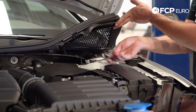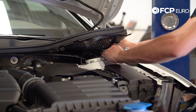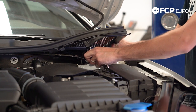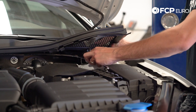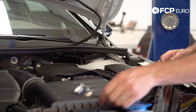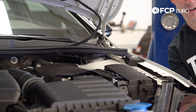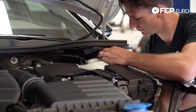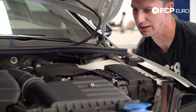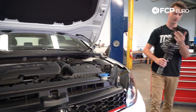I like to break all three bolts loose, then leave one in. I'll take two out, and the third one I'm going to do by hand — I'm going to come up under here, grab the strut, lift up on the strut, and loosen up the bolt. Once that bolt is out, two hands under here — I can lower the strut right out. Stock strut removed.